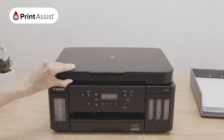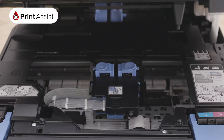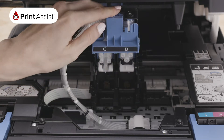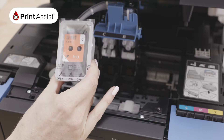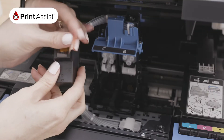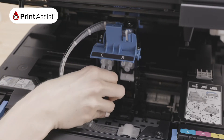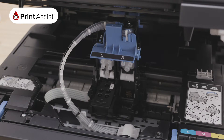Let's start setting up your new printer by putting the printheads in. Lift up the entire scanning unit to access the inside of the machine. Open the printhead locking cover by pinching the blue tab together and lifting gently up. Take out the C for colour printhead from the packaging and remove the label. Remove this protective tape, but be careful not to touch the printhead.